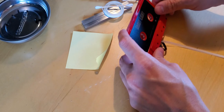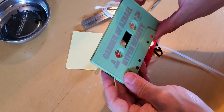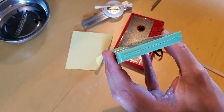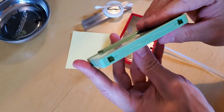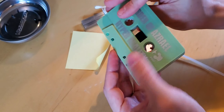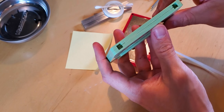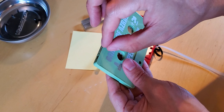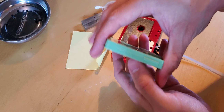If you're lucky, you have broken a cassette that has screws, because this is much easier to open than a sonic welded cassette. A sonic welded cassette has no screws. You can open it by taking an X-Acto knife and carving into it until you get through all the glue, but that does quite a bit of cosmetic damage. If it's a sonic welded cassette, it really is the only option. When you're done and reassembled, you'll want to drop little bits of super glue around the edges — making sure none of it touches the magnetic tape — to seal it back together.